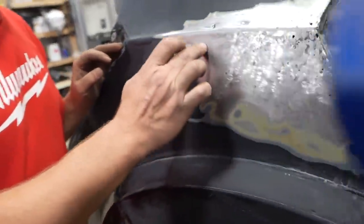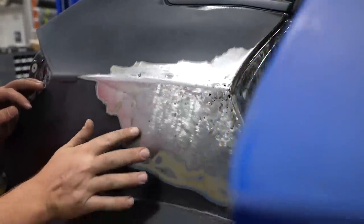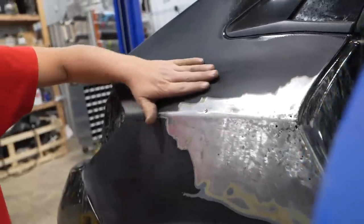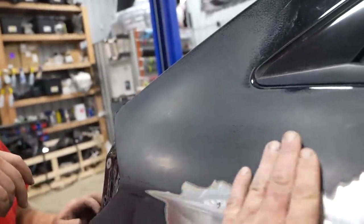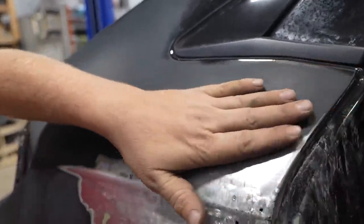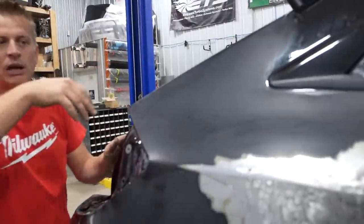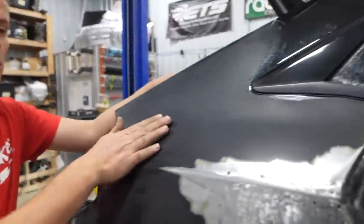Yeah, we have a low spot here and I think over here is pretty nice. I would just pull this low spot and we need to figure it out. What's going on over here? Remember, it's either a low spot or a high spot here, but I believe it's a low spot here. You think it's a low spot? It feels like a high, yeah. But if you're moving your hand over here, you don't feel that. I can feel it with the hand, but remember, even after applying wax and grease remover, you can't see it. It looks perfect, yeah. Yeah, but.